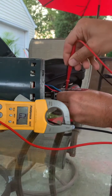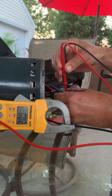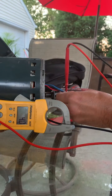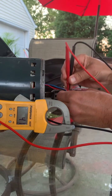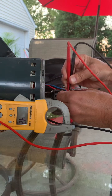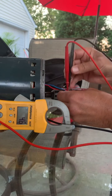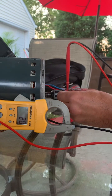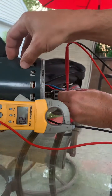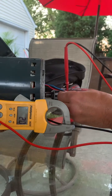I'm gonna get one reading: four five, four six. Then you go from red to black — if you made the connection a little tighter you'd get a tighter reading, most likely four five. Then if you go from blue to black, that's the biggest discrepancy: 2.0. This fan should have equal ohms on blue, black, and red. If you have any discrepancy, the fan is bad.